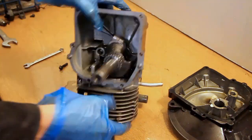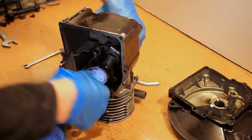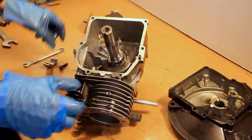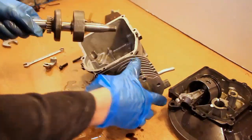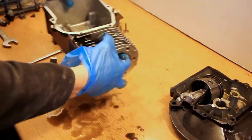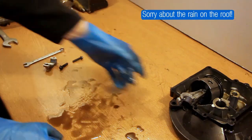I can now twist the crankshaft around and one of the ends of the conrod will come off, so you can then push the piston through. Just make sure that you reattach the end of the conrod so you don't lose it, and make sure you put the bolts in the correct holes together so there is no chance of mixing anything up or losing anything when you come to put it all back together.